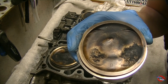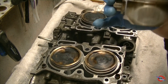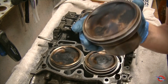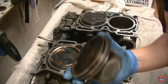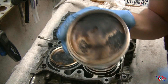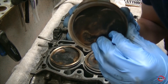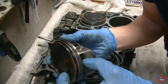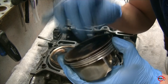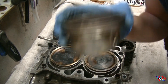It's not just a tuning thing. Maybe they need to retard the timing more. It is a direct cause because of Subaru's fuel system spraying the maximum amount of fuel being sucked in with gravity to the bottom of the piston. So the same area of the piston when it's knocking keeps taking all that load — and that's why we see these cracks, just waiting. Every time the piston's getting hit, just waiting to actually destroy that ring land.